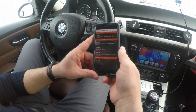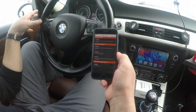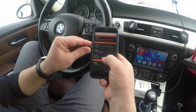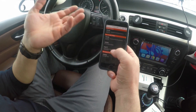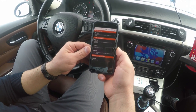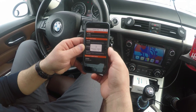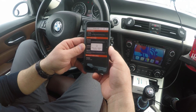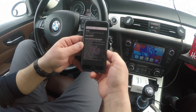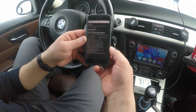There we have it. Going to Diagnostic and then Trouble Codes — with the other OBD we only saw P0140, but with V-peak we can see the last trouble codes as well: P0140, P2F0D, P2C77 — at least four codes. You can also click on each error code and it gives you freeze frame data: when it happened, engine RPM, coolant temperature, and more.